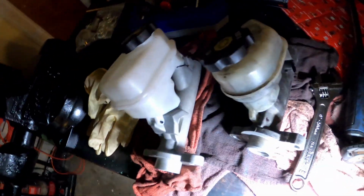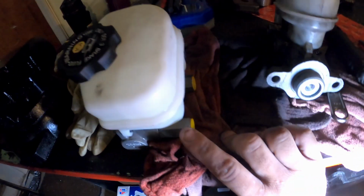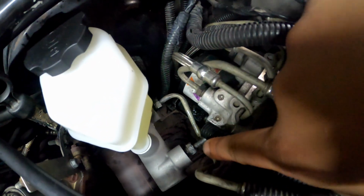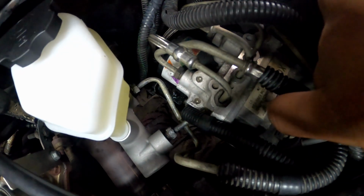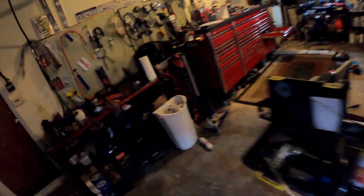So then I'm looking at the body. I'm like, that looks pretty similar. I go to mount it up with the mount right here. It fit, everything fit. Then I realized the fittings that this thing came with would fit in a car just like this if the ABS unit wasn't in the way. Y'all see the ABS unit is right here. As y'all can see where the fittings are at now, just imagine those little adapters there. These lines wouldn't fit with those adapters there. There wouldn't be no space, unless you move the ABS out of the way. I'm not doing that. It's not what you're supposed to do. Now, if you take the fittings off, like I did, because I was like, okay, let me just take the fittings off.